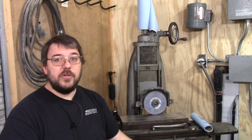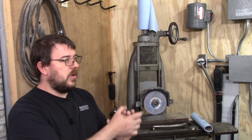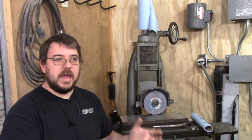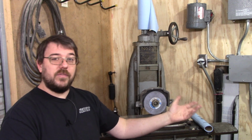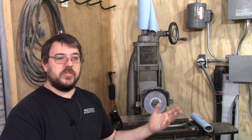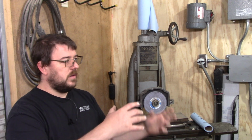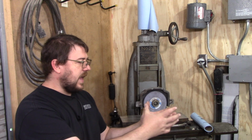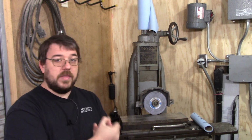And unfortunately, normally when you get regrinds, you put adjustable cam phasers on there so that you can phase your cams exactly, you degree them in and your motor runs properly. But in this case, we've got 4 cams that all have VVTi on it. There's no way to adjust it. So they have to be ground properly, and if they can't be ground properly, they have to be binned so that your intake cams are the same and your exhaust cams are the same. And then it's easy, right?